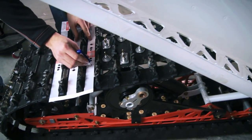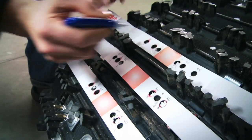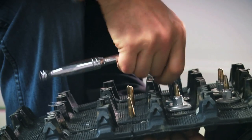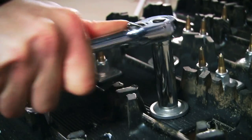Conversely, too little studs in your track can result in oversteer, with the rear of your sled sliding out and feeling loose in turns. A properly balanced sled will optimize your turning control along with maximizing acceleration and braking performance, thereby helping you to stop sooner and get better grip in icy or dangerous conditions.